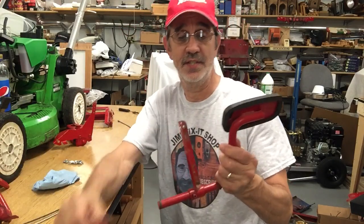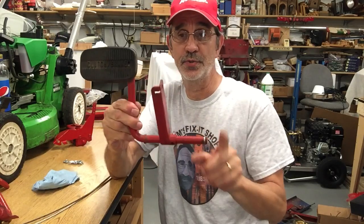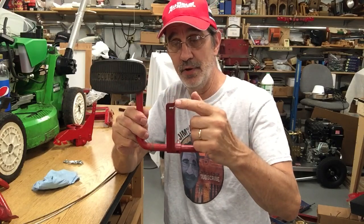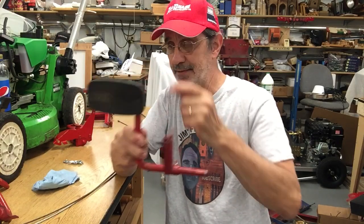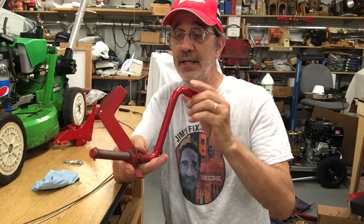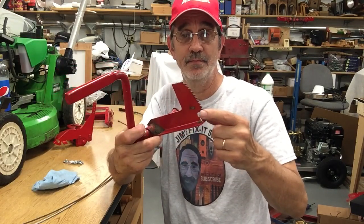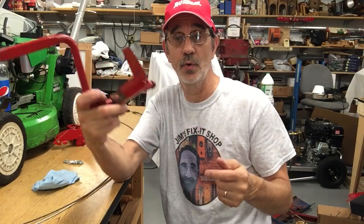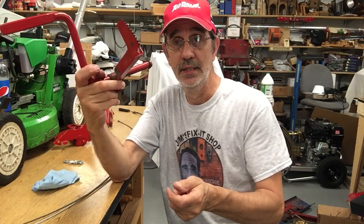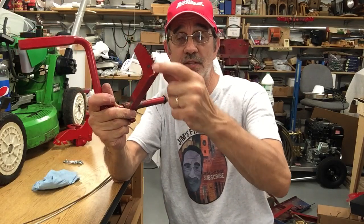Or they have this style — this is one that's in the SR machines. It goes through the front frame and the cable hooks inside the frame, not on the outside. And this is another style for the SR: it goes through the frame but this one has teeth on it, and this is what locks your parking brake. You push the brake pedal down, lift up on the handle, and it catches in these teeth and locks the brake.